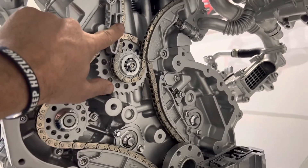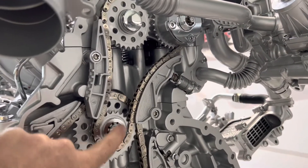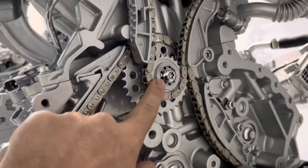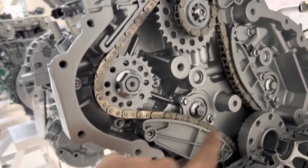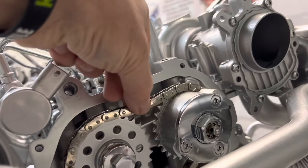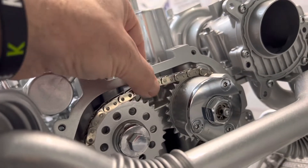What we can see here: there are two chains — one of them running from an intermediate shaft to both camshafts, and another one from the intermediate shaft driving the pump and towards the crankshaft. The first symptom you'll hear is a rattling on startup.